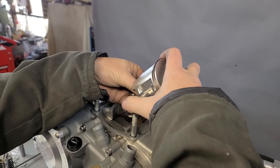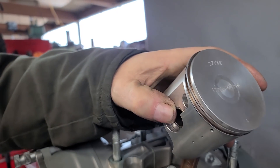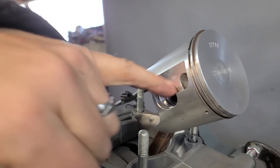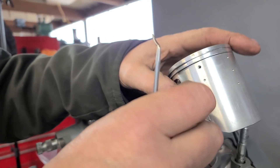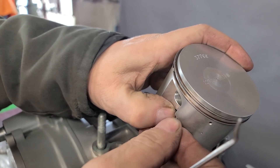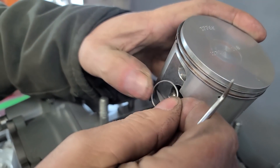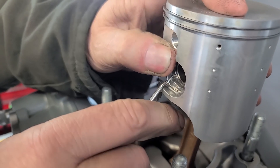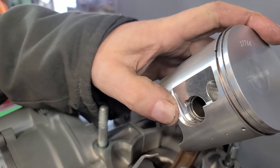I'm just applying a little bit of pressure on it and it'll eventually line up and go in. One of the things about the 310s that has always been an annoyance for me is how hard it is to get the pin in. But I had seen a video from Mike Sabo - a great channel, go subscribe. I leverage this down; he did it better than I do but it works way better than what I used to do. Get the clip in underneath here and just roll it up into there and lock it in place.